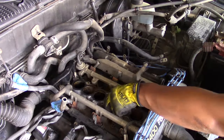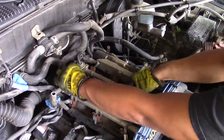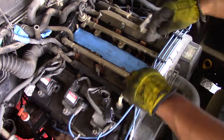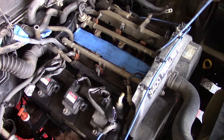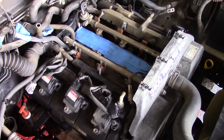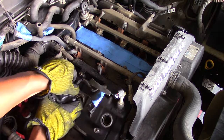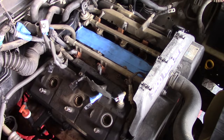Now with the intake completely removed, you see there are another two gaskets to replace. Also, cover up your intakes with some tape to make sure no foreign material drops in there — that's a very important step. Next up is your spark plug wire and spark plug removal; it's a good idea to change these out while you're in here. I do have a full video of this process in the description below. I thread the valve cover bolts back in to the valve cover just to avoid losing them.